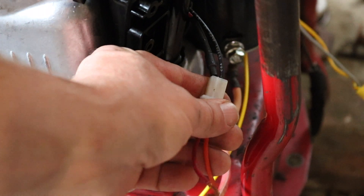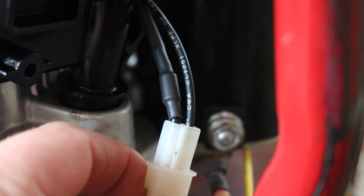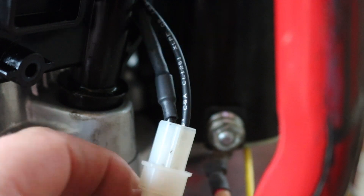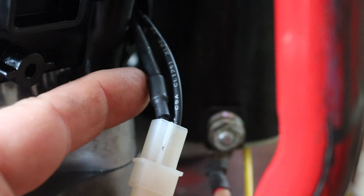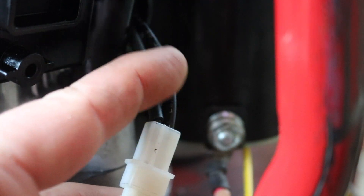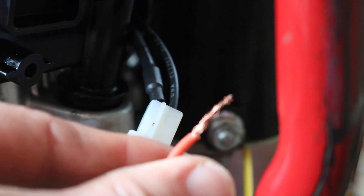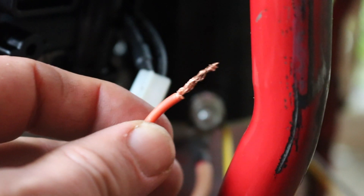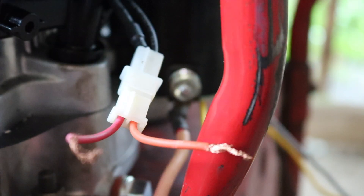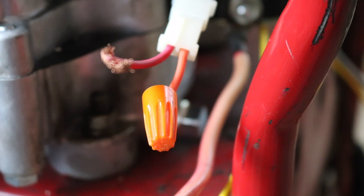There's a connector that comes out of Briggs & Stratton with two wires — one wire is fatter than the other. The fatter one has a diode, and that's going to be your alternator or stator — it's what charges your battery, so this goes to the battery. The other wire can power your lights; if you had lights, you could simply run this wire to them, and it would only run while your engine's running. I don't have any lights, so I'm just going to cap it off. I've successfully terminated it and I'll put some tape to make sure it never comes off.